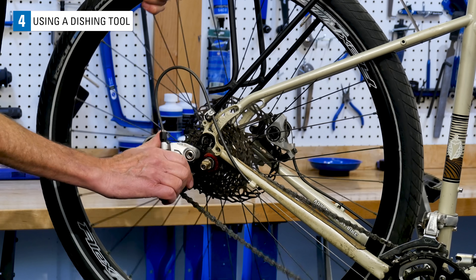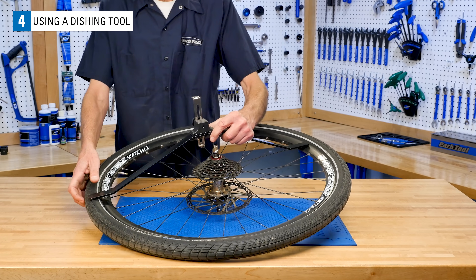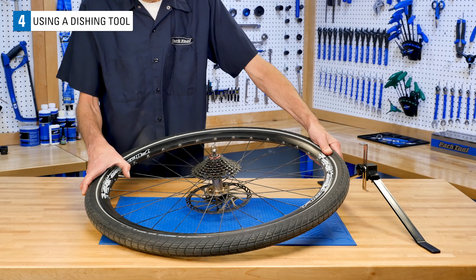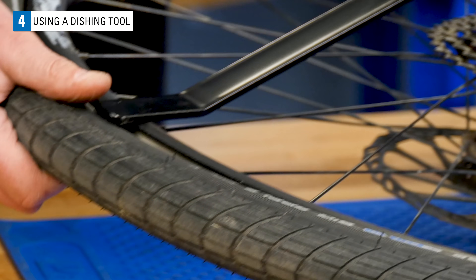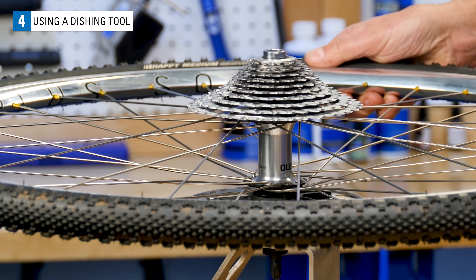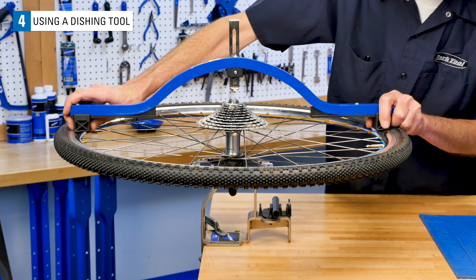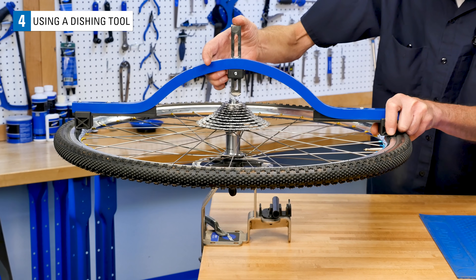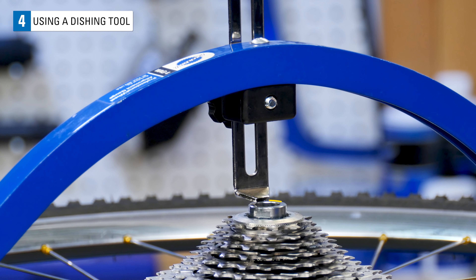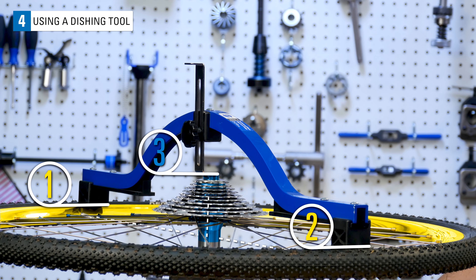To use the dishing tool, it is easiest to remove the wheel from the bike. For consistent work habits, lay the wheel flat on a bench with the right side or drive side facing up. If you are using the WAG-5 or similar tool, be sure the legs of the tool contact the rim and not the tire. If necessary, deflate the tire and fold it back so the tool legs are on the rim. The WAG-4 has sliding feet allowing rim contact even with the tire still in place and inflated. With the feet of the tool on the rim, lower the sliding indicator until the end rests on the part of the hub that contacts the inside face of the fork or frame dropout. On thru axle wheels, that is the face of the end cap. These three points of contact represent the centering of the rim relative to the right side of the hub.